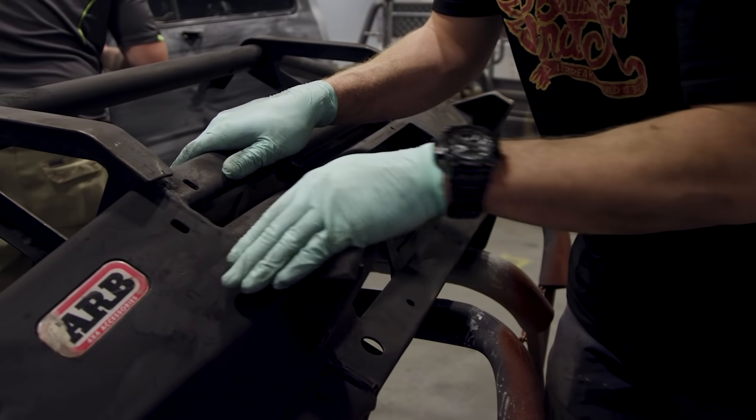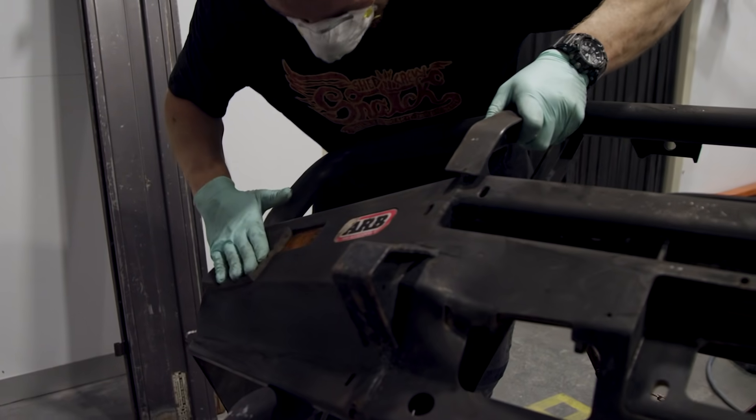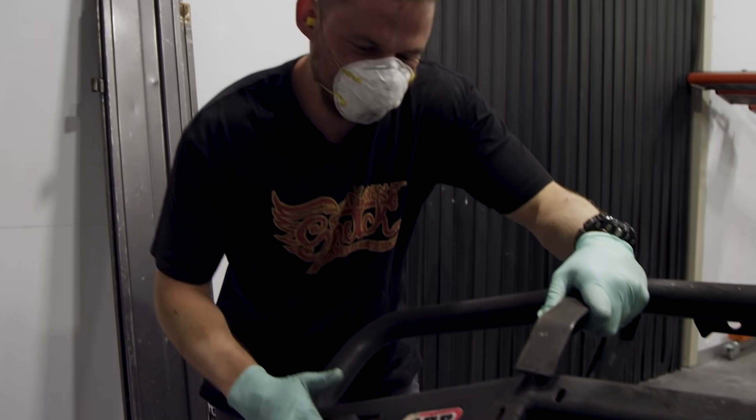The second question is from 40449 who asked: is it as hard to do as a proper paint job? No, it's not — Raptor is actually much more forgiving to apply. But the trick with Raptor is to make sure you spend the time preparing the surface properly, just like with any paint job. Painting is in the prep work, so take the time and set it up properly, but when you actually come to painting it's way more forgiving than normal paint.